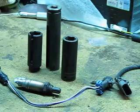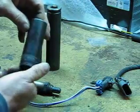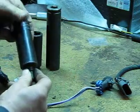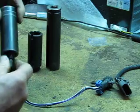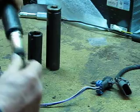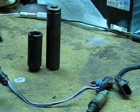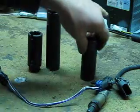Now these sockets — this is a standard socket with no special provisions, and you could put it on a sensor. A lot of times the socket is too short internally so it can't even accommodate the sensor. Sometimes if it's a little deeper it fits, and you could do the same deal — cut the wires off. But a lot of times you need to save the sensor, like when transferring it to a replacement pipe or converter, so you can't cut the wires off.